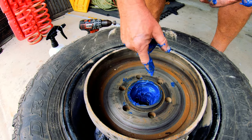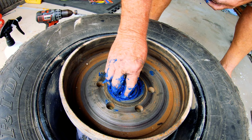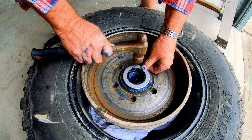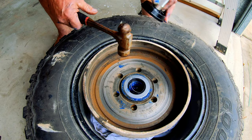Fill the inside of your hub with grease like that. Then sit this one in - all right, so she's nice and seated. Seal goes in here mate - just get him started. Flush - flush, a little bit high there.